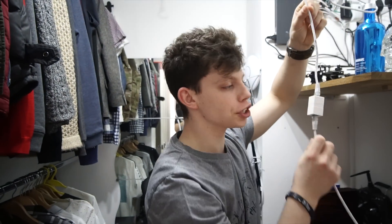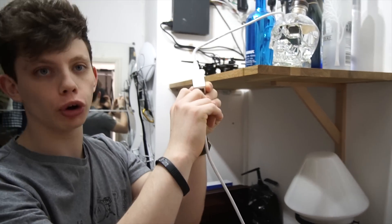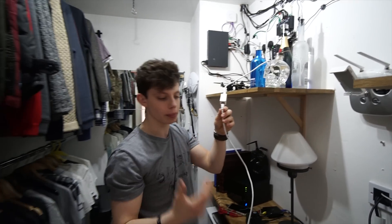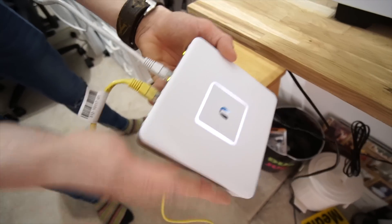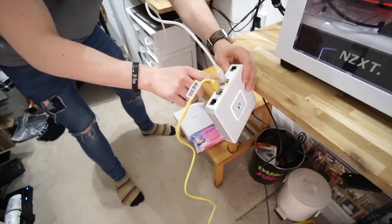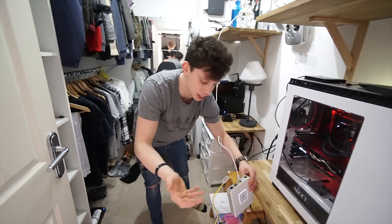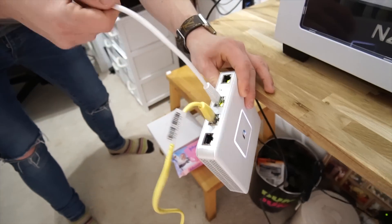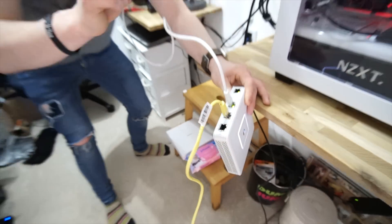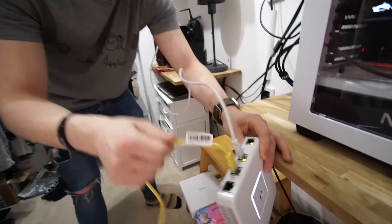This white cable — let's just pretend this is the ethernet cable coming from your home broadband, the ethernet jack from your ISP's router. This is going to go into the USG, the router of your new network. Most typical routers have a switch on the back with a few ethernet ports and built-in Wi-Fi, but not this one — all devices are separate. We have our WAN1 which is the internet in, and then our LAN1. There's only one local area network port, which means we can only plug in one device. Therefore, we need a switch.